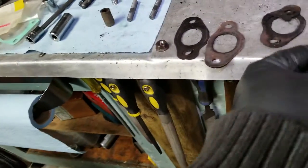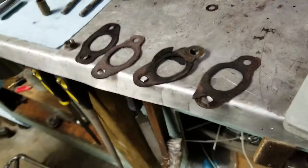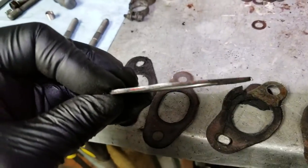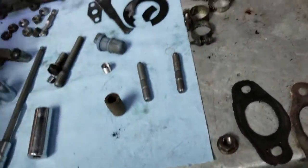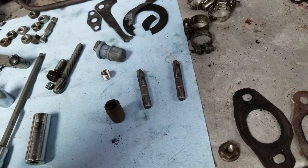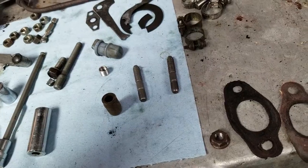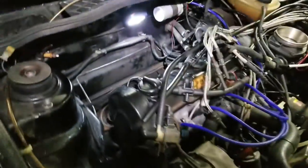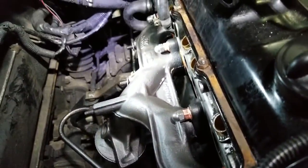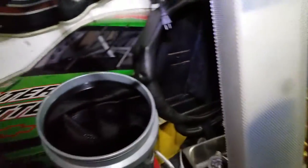You can also look at where other sources of unmetered air may have entered the system. These are my exhaust manifold gaskets — here's a new one for comparison. When I install these I'm in the habit of using Permatex Ultra Copper, an orange-ish color, good to 600 degrees Fahrenheit continuous and 700 degrees Fahrenheit intermittent. I replace those to reduce the chance of air leaks. And I'm impressed with this product — Evapo-Rust — which gets that manifold looking like it's been bead blasted. I then use a clear ceramic VHT high-temperature paint to coat it.